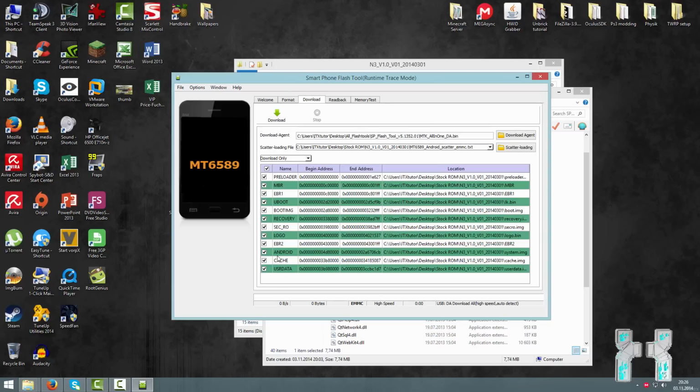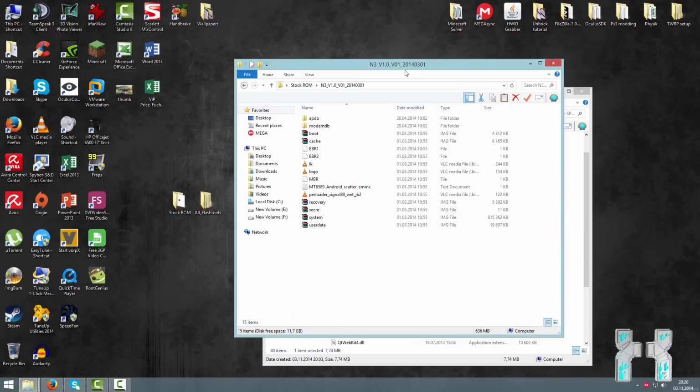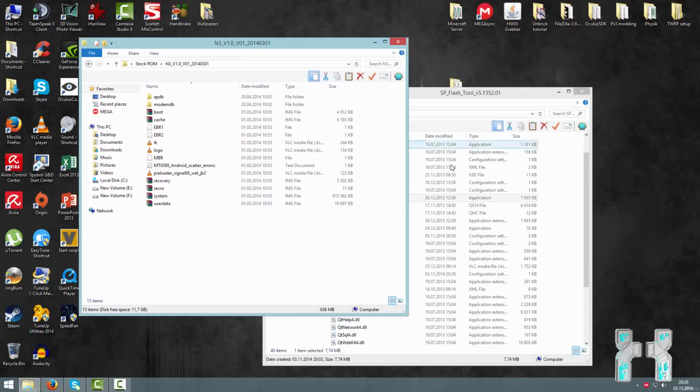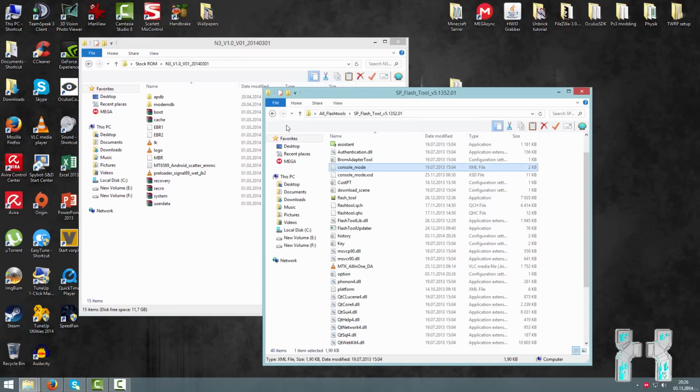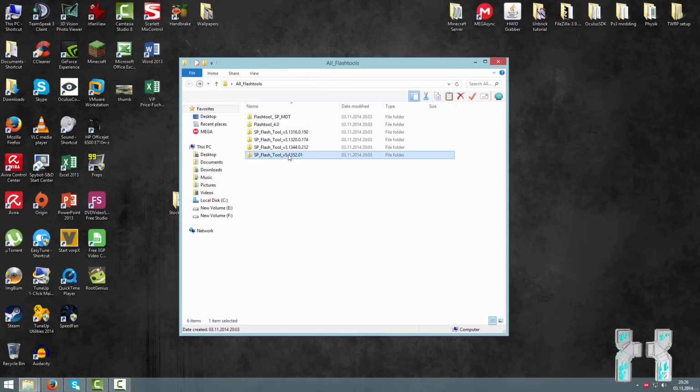Now, if you get an error in SP Flash Tool like 4032, usually means wrong ROM. Something which is 8032 or something is usually a driver issue. You can check that out in the link down below in the description. I have some errors listed and you can see what they mean. But you also should try different versions of the Flash tool. And do it like this, so start with version 5 and then you go back until 3.1 or something, okay? So go from the latest to the oldest SP Flash Tool version and also check which error codes you get.